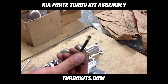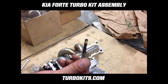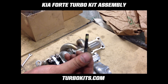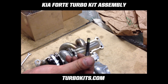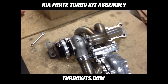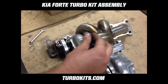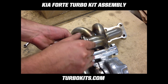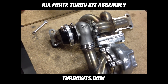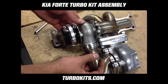There's a stick coating on the bolt — the Teflon coating there. As the nut goes over that it will seem very hard to spin through. That is how it's going to be, so don't freak out — you're not stripping it. Just keep going; it'll get past it and lock itself into place. Now we've got it hand tight and it still moves around, and we can move the clamp around as well. We're going to take the other smaller clamp and line up the wastegate outlet port to the turbine outlet pipe and clamp them down together.